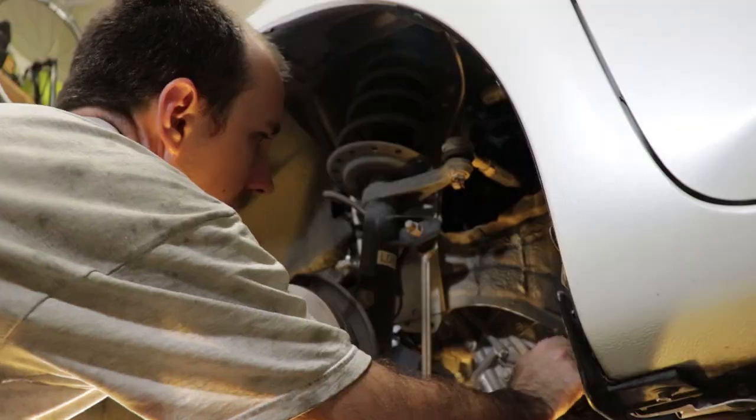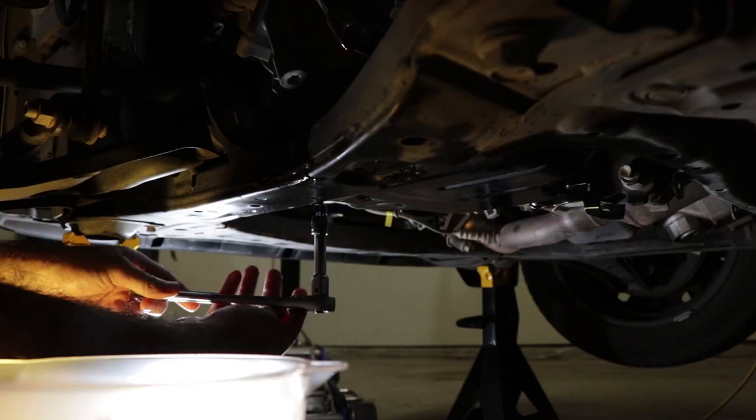So we're gonna drain about a liter out, and then we're gonna do the procedure to check the level, and part of the process in that procedure is remove the drain plug with the engine running, and if the level has been set correctly, a little bit will flow out of the drain port. So what I'm going to do now is put the fill plug back on. I'm going to remove the drain plug and drain out about a liter, and then I'm going to put the drain plug back in and then do the check procedure. It goes back in there.